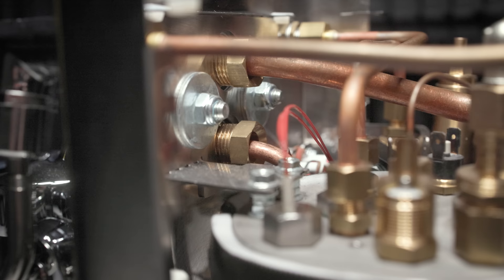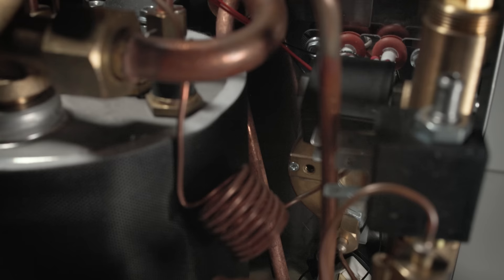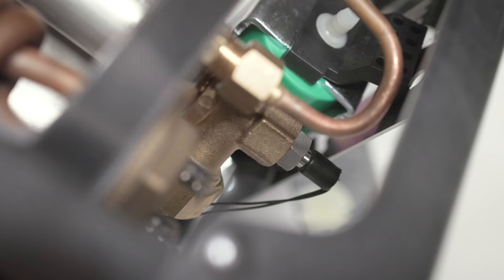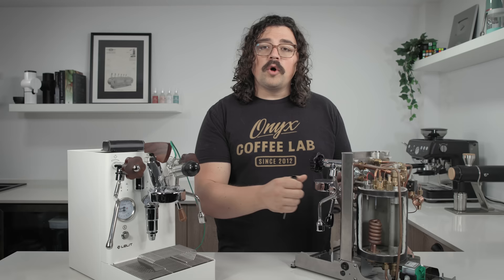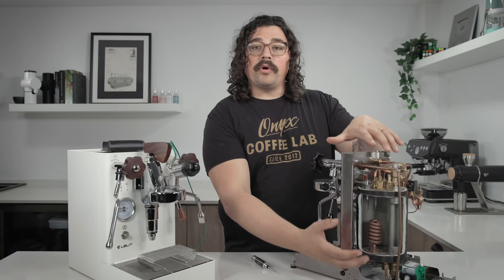As the water heats up and is ready to escape, it comes out through this thick copper tube into the group head itself. It goes through part of the group head and then re-escapes out, creating a thermosiphon effect through this copper tube right here, which goes down, traces the back of the boiler, and meets back up underneath to re-enter the chamber. That's cool water being mixed with the already hot water siphoned through the group head. The water doesn't fill up the boiler all the way because we need headroom for steam to accumulate — whenever you open the steam valve, steam comes off, and that brew tube just keeps getting hot from the steam boiler.